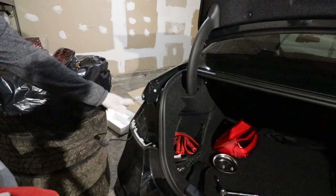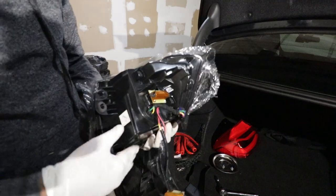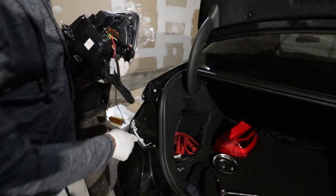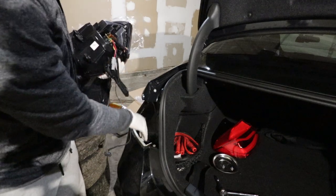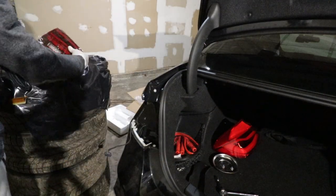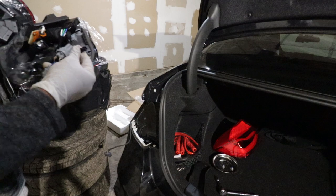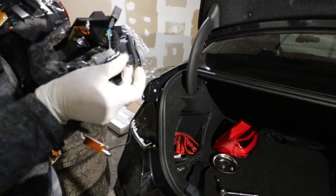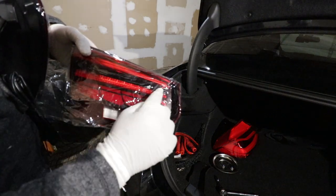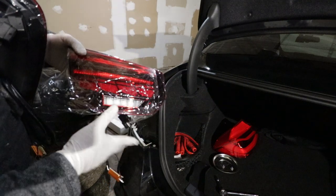What I like to do is, because this area is a little dirty right now, go ahead and clean it up so that it's nice for the new tail lights. On the back of the tail light — version 2 at least — you have all these connectors. Some of these you just have to relocate them into these holes right here so that you can push them and hide them. This cable is pretty much going to be attached to the second part. There's a little screw place right here — this is where that long cable is going to be attached to. This is so that whenever you brake, this portion of the light will light up. If you don't plug this long cable, this portion is not going to work, so you want to plug that so you can have everything working properly.